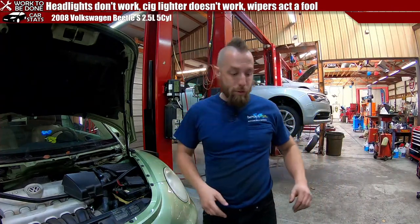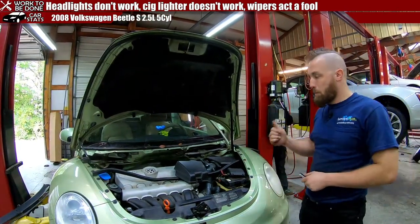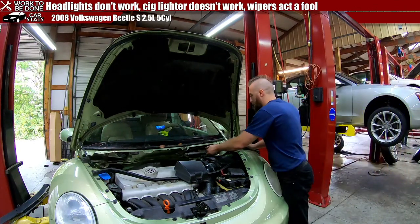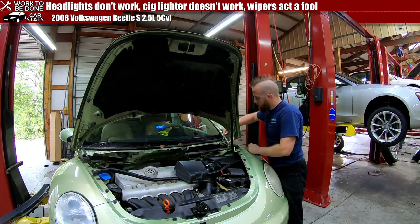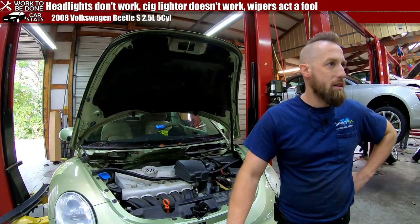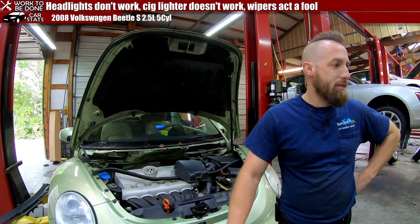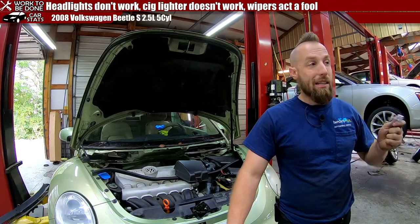All right, so our wipers have worked. So that's good. There's nothing wrong with the motor, nothing wrong with the connection. I do believe 100% at this point that it was shorted due to all of the junk in there. That's why she said it worked once and then it didn't. The exact complaint was: windshield wiper stopped working, comes back on its own after cutting off. And since the wipers were buried in leaves and the connectors are exposed,